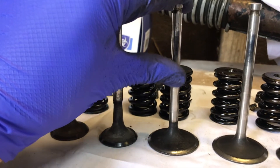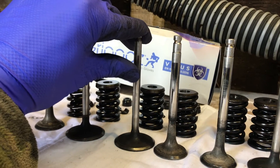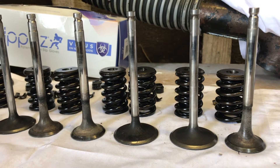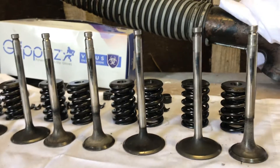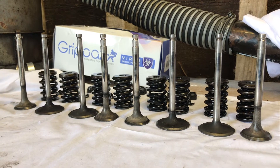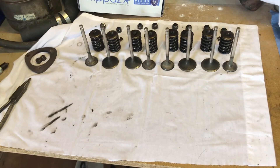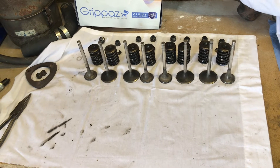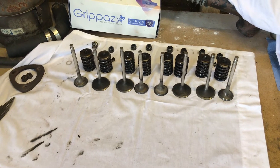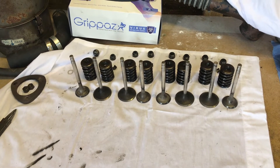The question is whether we can lap them sufficiently - these are scuffed and worn. When they're in the guides I could put a dial gauge on them to actually measure the play, as you do get guidance for the acceptable amount of play. We're looking for compression improvements because what started all this is crankcase pressure spitting oil out the filler. I'm undecided, but I'm going to try lapping the worst example and see how that goes. I also need to check the surface of the head against a straight edge and some feeler gauges.